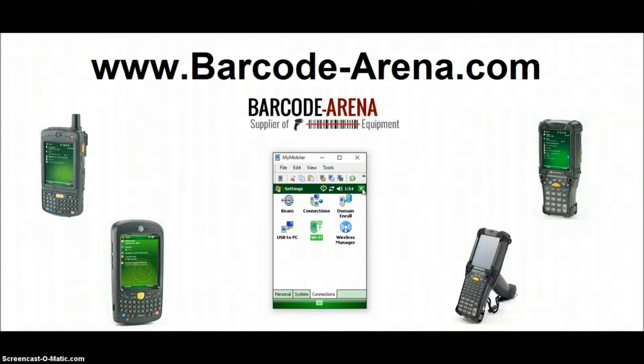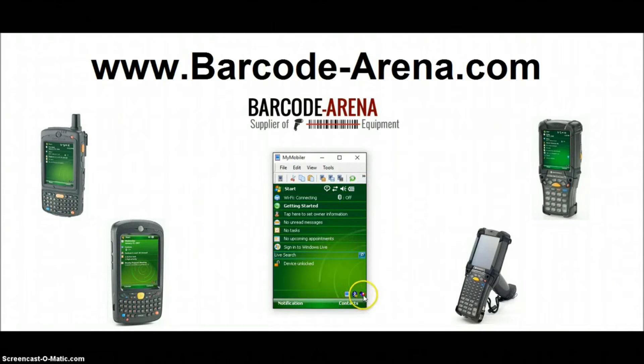Exit out to the home screen. The little blue icon in the bottom right with the red diamond over it is your Wi-Fi radio icon — this is your home base for changing any Wi-Fi settings. Click that to get your menu, then click Options. In the dropdown, select Regulatory from the list and uncheck that box. Most standard Wi-Fi networks will not allow the device to connect when that is turned on.